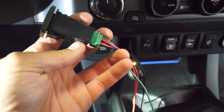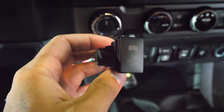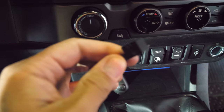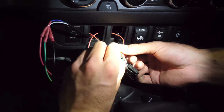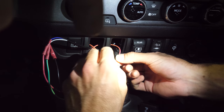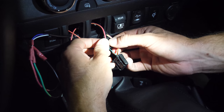What we want is a switch that's more square and matches the other switches already mounted in the truck. This is from Amazon — I'll link it in the description. In order to get this button to light up automatically when it clicks on and off, we need something called an add-a-fuse, which plugs into the fuse box and has room for additional fuses up top to give power to the new switch. However, the add-a-fuse extended the fuse box out too far so the cap wouldn't fit anymore, so instead we're going to jerry-rig it by tapping into the power wire of the button next to it, wrapping our new button into that same line without actually cutting the wire, then insulating it with electrical tape.